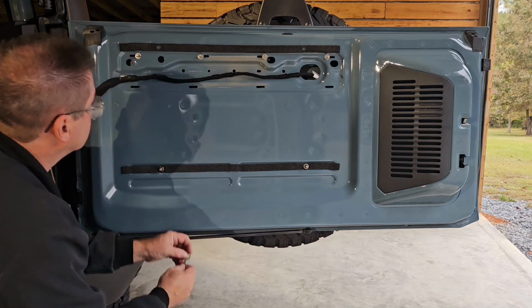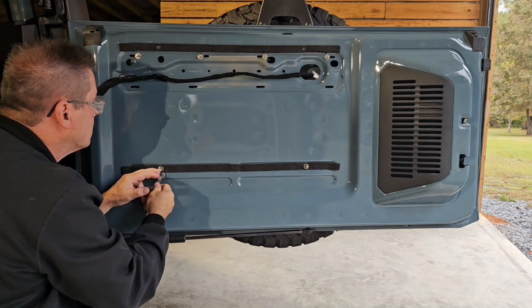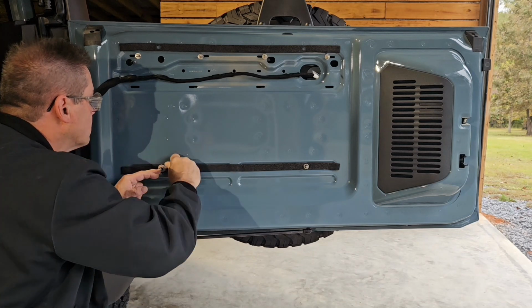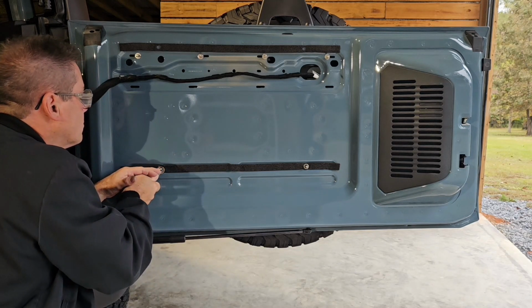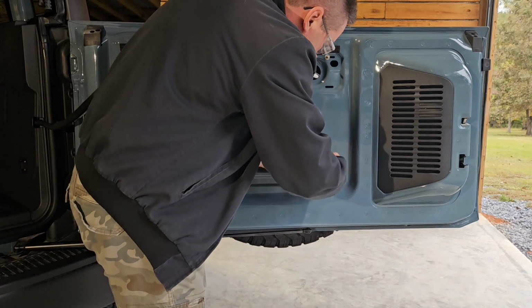Here I'm tightening the T-bolt lock nut down so that the T-bolt can't move. I'm using the included small wrenches to show that you don't have to have any other tools. You want to snug them up but not over torque them, and do this to all 4 at the top and 2 at the bottom. And then we'll place a washer over the stud before we put the table into place.